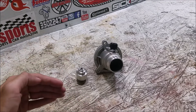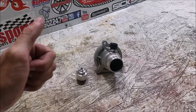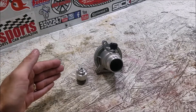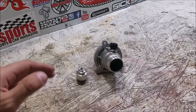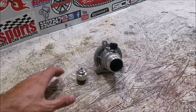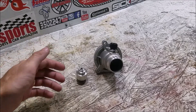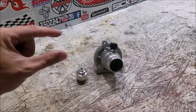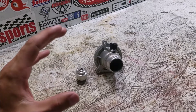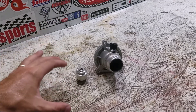BMW has better emission standards and better gas mileage as an overall fleet, but they're not really concerned about how long the engine lasts. If you bring down those oil and water temperatures to a more reasonable level, your hoses are going to last longer, your plastics are going to last longer, your engine is going to last longer, it'll consume less oil, and you'll have less issues overall. If you're driving hard, you have that much more margin of safety for track, drag strip, or mountain road use.